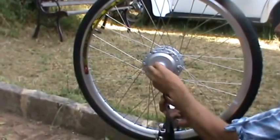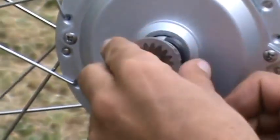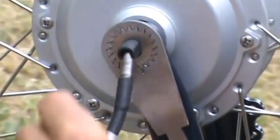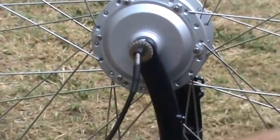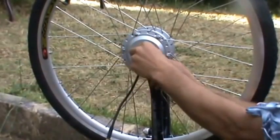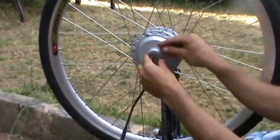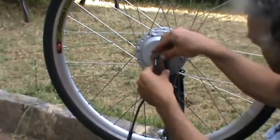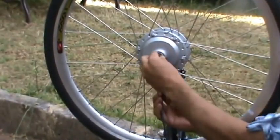I typically put it on the side with the cable because the axle is a little bit longer on this side. Line it up as well as you can with the fork. Sometimes there's a recess in the fork, in which case you have to put this in a vise, bang it with a hammer and put a nice bend in it. Then put it on, tighten the nuts, bang it back against the fork and then clamp it. This is the most important and slightly tricky little bit — it's really just an extra safety feature. If you have a good set of chromoly steel forks, it's probably not necessary, but I recommend putting it on all the time.